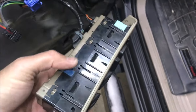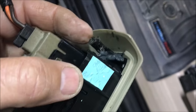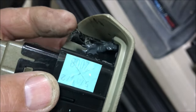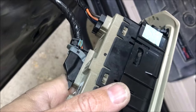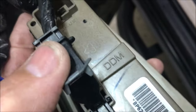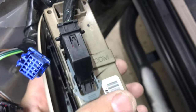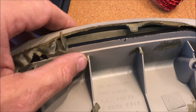I found that without being able to see the back of this switch and this little mechanism, it was easier for me to reach inside the door panel and remove the screw that went into this pillar. You can see that thing was broken previously and somebody had hit it with JB Weld. Now I'll disconnect these two plugs. To get the gray lever free, just push down on this little black tab in the middle - the lever was in the up position, push down with a screwdriver, then slide it back and that plug will come out.